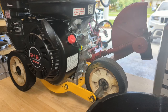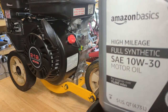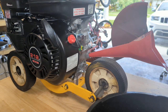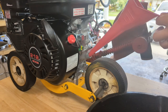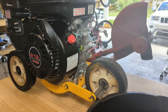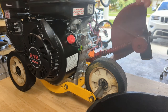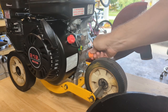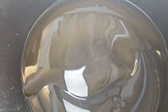Let's add some fresh oil. I'm going to use regular Amazon Basics 10W-30. Some people say you should use non-synthetic when breaking in — it really doesn't matter all that much. It's outdoor power equipment, not the space shuttle. Got a little bit too much in there, it'll just drip out. A little glittery.